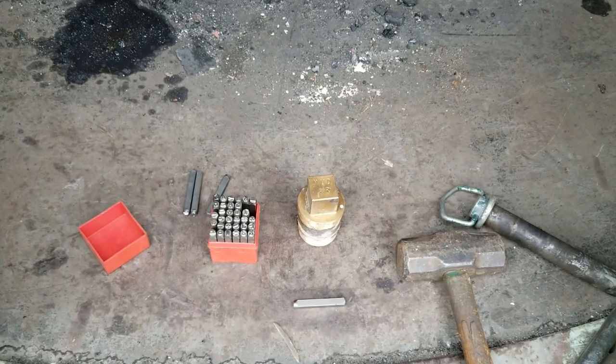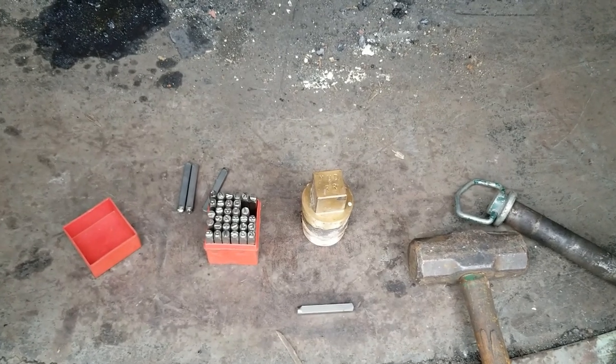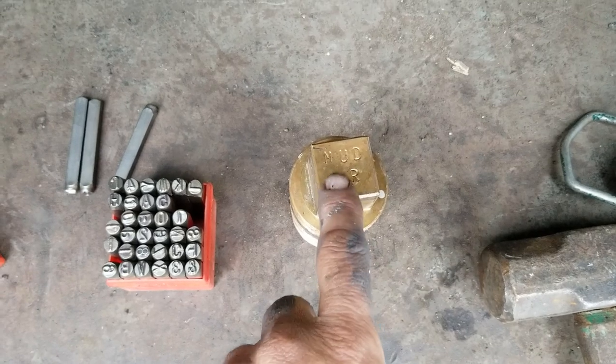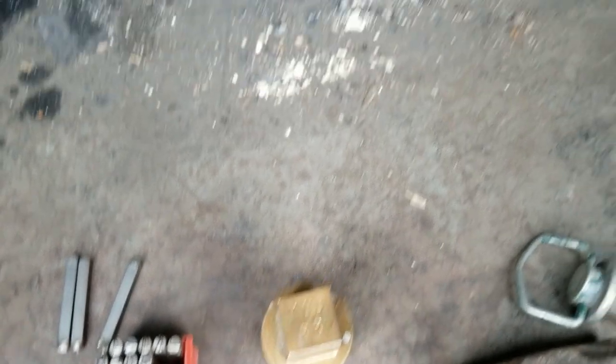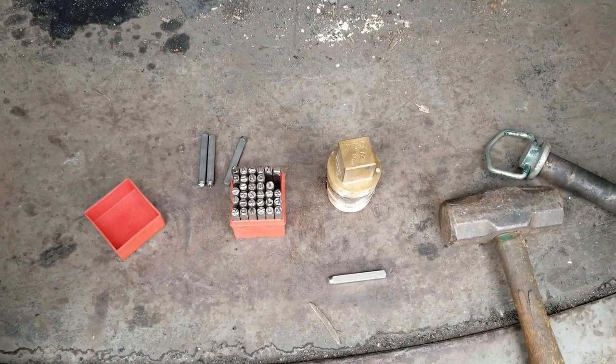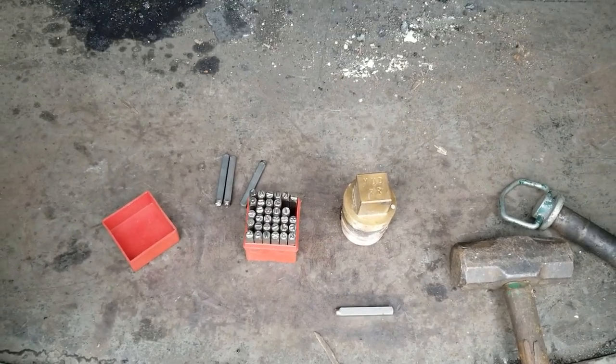One other thing I'm going to do here, which I haven't done before, is identify each plug with the hole they go in. So this one here — mud ring, right rear — which means it goes right there. I'll do that for all the plugs so they won't get lost and they all go back where they belong.